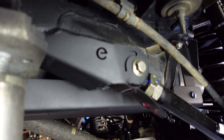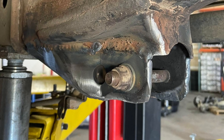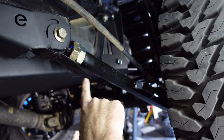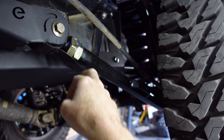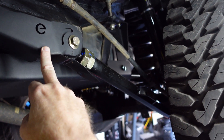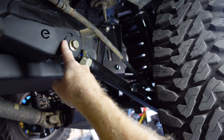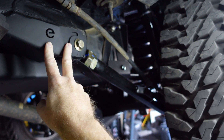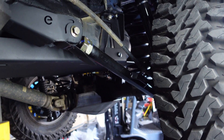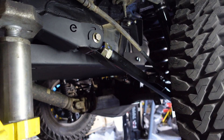Moving to the front of the rear axle, this is the same manufacturer as the Panhard bar relocation kit — it has to be welded to the frame as well, and they did an excellent job. Here you can see the beefy lower adjustable Dobinson lower links with a kind of skid there to keep damage from happening to the adjustability nuts on the lower links. When you go long travel and beef up these lower links, they have a tendency to tear and warp the factory mounts. This basically braces the factory mount and also gives you a skid to slide off of in case you hit rocks. And you will hit rocks right there — I know I have done it several times. These didn't cost very much either, so you'll have some labor in getting it welded up, but it wasn't bad.